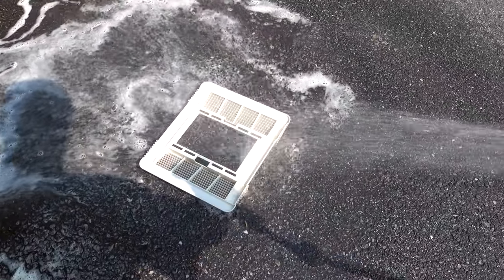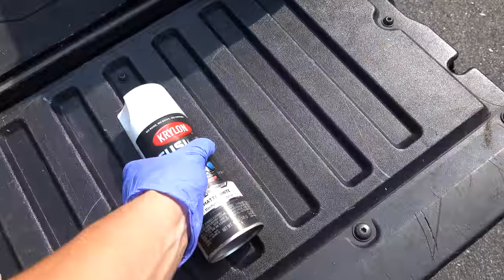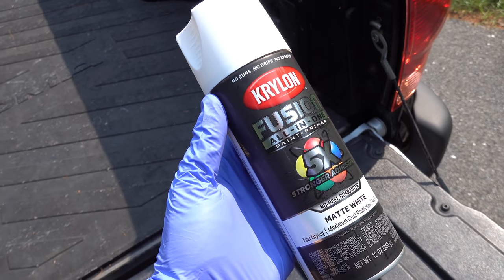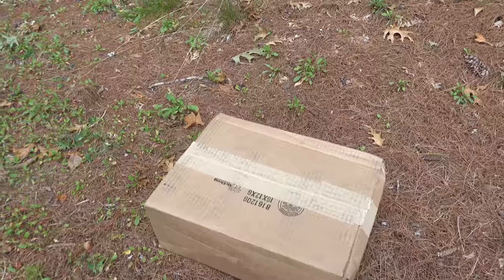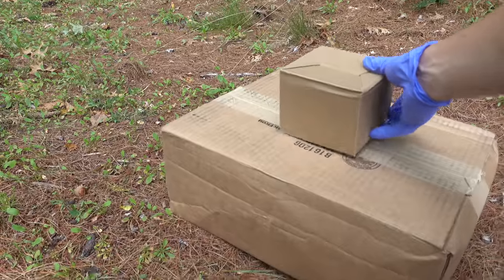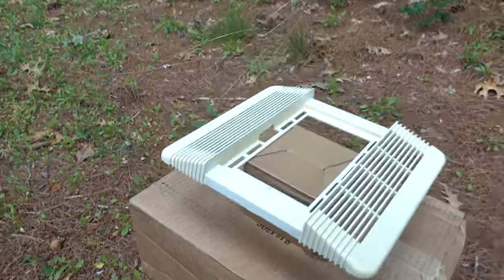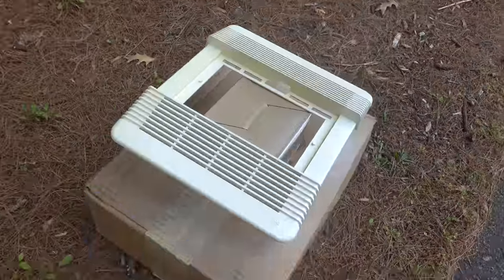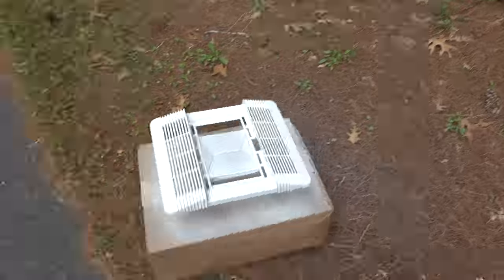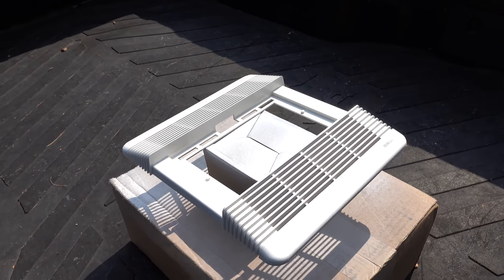The grill is looking really clean but unfortunately it's still yellow, so for our next step we need to let this thing dry thoroughly. Here's the secret that's going to make our grill look brand new and in our case bright white. You can paint it any color you want, but make sure the spray paint you're going to use says it's safe for plastic. Grab a scrap piece of cardboard and get some sort of a box so that you can prop the grill up — if you put it flat on the box, the paint will kind of glue the edges of the grill to the cardboard. Now break out your spray paint and start to spray a light, even coat, spraying from different angles so that you get all edges of the plastic. In just about a minute for less than 50 cents, you've got a brand new looking grill that is bright white.